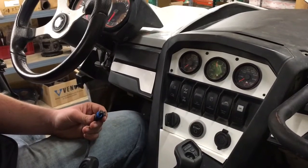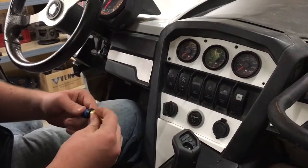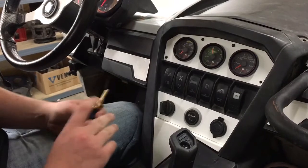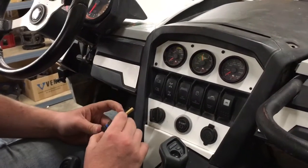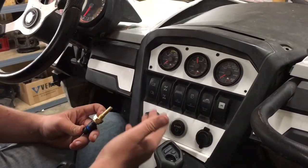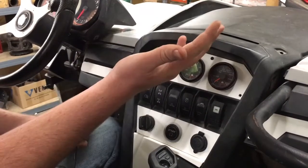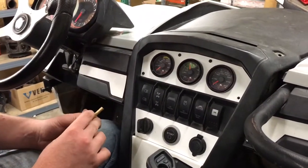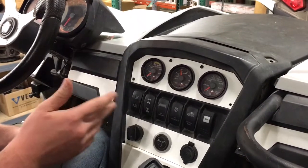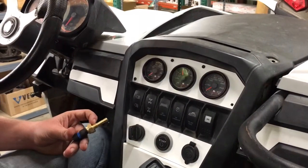Now we're going to check our programming, because before we get out on the trail it's always good to verify in the shop. The gauge takes a 20-second average of temperature and gives you a reflection of that 20-second window. So if we heat up the brass sensor to 200 degrees in 10 seconds, that's an average the gauge isn't going to be able to compute — it's going to randomly spike the needle up. Long story short, we need a nice 20-second window of slowly heating the sensor up, as it would be when used in the car.